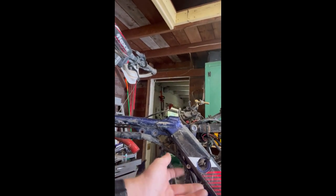So if you pulled your fuel pump off — pulled those screws out and set it to the side — you can actually get in there and see that, and that'll help you adjust your idle. Super simple, you don't have to turn it very far to idle it down or speed it up.